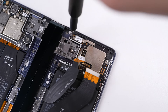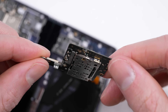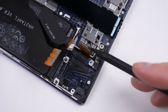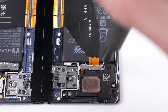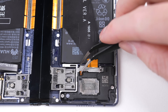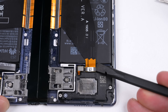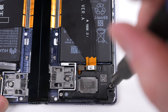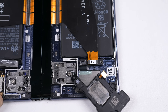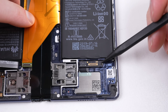While we're at it, let's take a look at this board. This is the SIM and Nano memory slot for fitting Huawei's expandable storage. Unexpectedly, the display also connects to this board. Down at the lower section is the speaker. Its cable is hiding under a pesky bracket that's not only screwed but clipped into place. After unfastening the screws, it can be lifted out of place. There is still a small PCB left — it can be pried out, though it's not immediately clear what it's for.